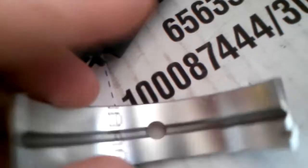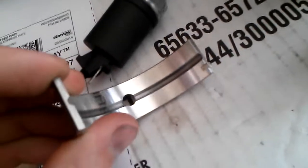This is horrible packaging on the part of Mopar. I don't know why you'd put main bearings like that. This one's not too bad — it looks okay, but if you look there, there is some scoring. If I put my finger on that I can feel the scoring on it. This bearing is no good. If I put this in the engine, my engine is going to fail pretty prematurely.